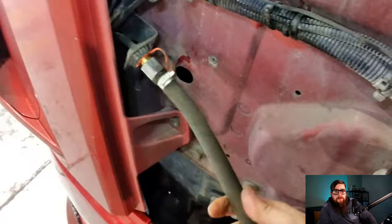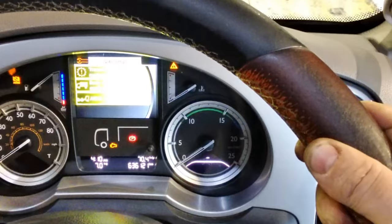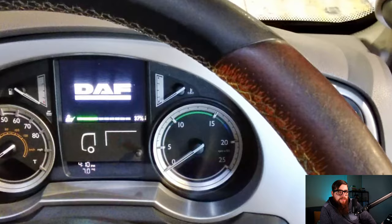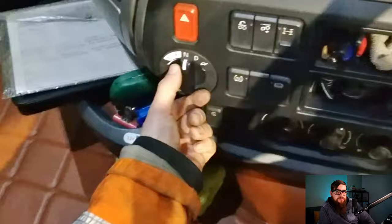With the software finally installed on Davey, we'll need to fill tank 4 with air as I drained it earlier. We can use this emergency test point to do this, which is found here. With the air pressure now built up, we can cycle the ignition to force the gearbox to do its pre-start checks, one of which is: can the box be put into neutral? As you can see, we have a nice N on the DIP. This week's abbreviation explanation is DIP, which stands for DAF Instrument Panel.